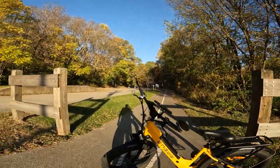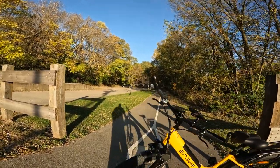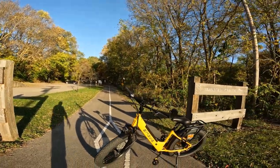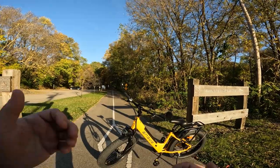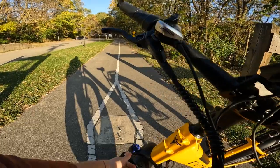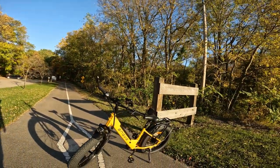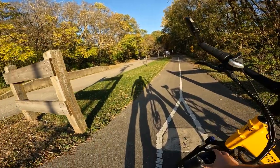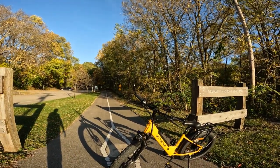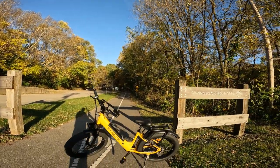I did have issues with the front tires I talked about on the last videos. Also, the spotlight, or it's so bright, I call it a spotlight. But the front light is almost as bright as a spotlight. It has a lot of power, and I did have some issues, and it's still needing to be worked out a little bit. The washer that they give you to put on the front, I don't think it's big enough. So I had issues with it. Every time I'd hit a bump, it would just wobble and wobble and move left and right. I still need to fix that. I just put a bolt in there right now. Obviously, that's not gonna stay that way. Just to put it on there so I can ride it around a little bit.